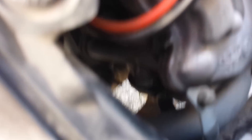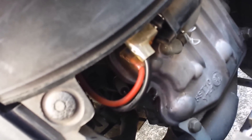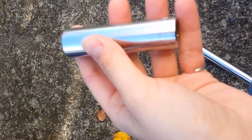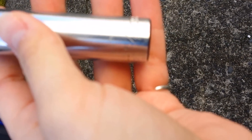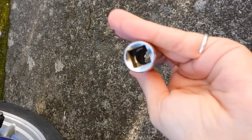We're gonna move that out of the way. Right above that red wire — that's my spark plug right there. So I'm gonna get my tools and try to pull it out. I've got my tools to do my spark plug extraction. What this is — this is a special socket, a spark plug socket. You can't really read it very well, but it's a 5/8ths spark plug socket. These are specially designed to take out a spark plug.